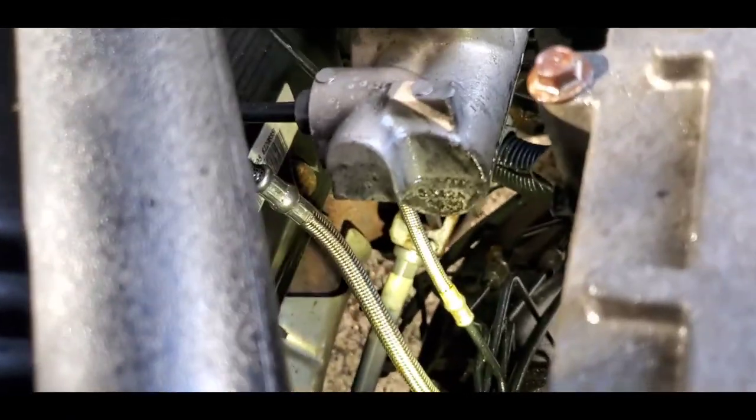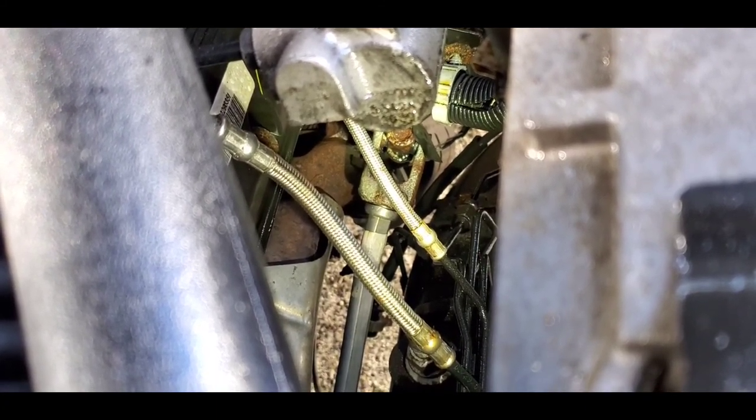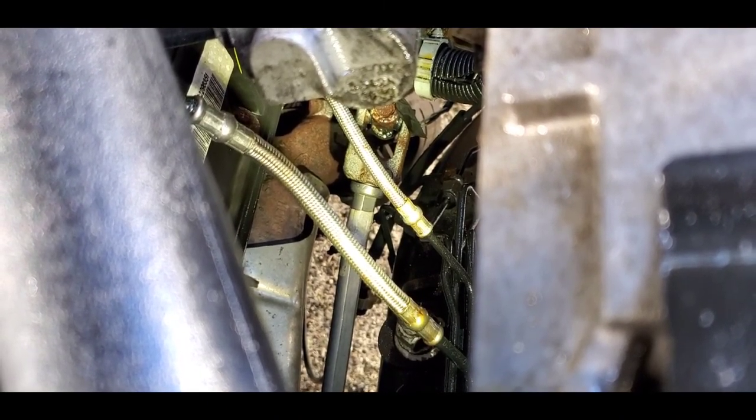What I did - I think that's a better view from up here - I filled up that bottom cap area a few times and I'm letting it soak. Then I'm articulating the wheel, just turning the steering wheel where the next cap is going to be down, and we'll let gravity flow the Blaster into the next cap. I've already done the one on the top and the one on the bottom on the top part of the shaft. Now I'm doing the ear on the top and bottom of the bottom shaft.